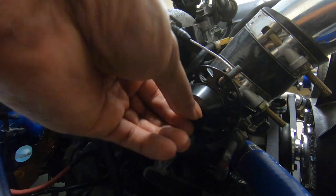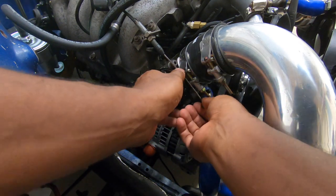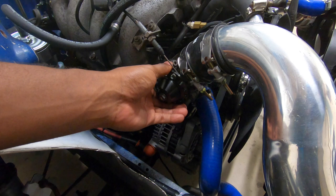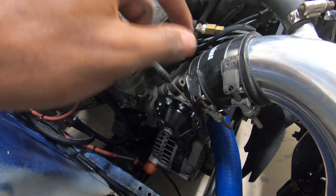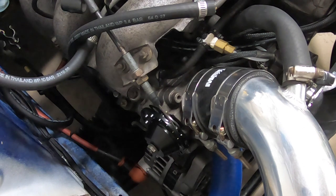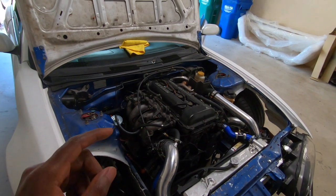I'm going to put this back on. I got it on and tightened it down. Last thing I need to do is put this cable back in — I tried once already because I forgot to hit record, and it's kind of hard. It's not closing all the way so we might have to do some adjusting. I adjusted these two nuts to where it was before so it closes fully. Now I need to make sure it opens fully — I'm going to zoom in here, go press the throttle pedal, and make sure it's going all the way back. We'll know right away if it's not installed correctly because if it's misadjusted it's going to have a high idle once I turn it on.